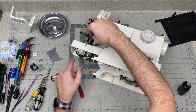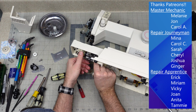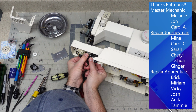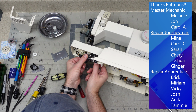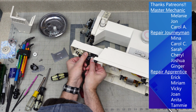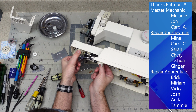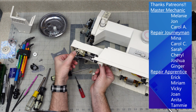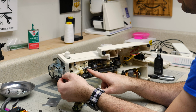And then start moving, so you got to move this over and slowly work it out. And then once it comes to this point, then you can start pulling it apart. And then you have your two pieces. So we can put that there for now because we're going to need this later. There's a spring inside here that holds your preload on this bushing right here on your shaft. So don't lose that spring.